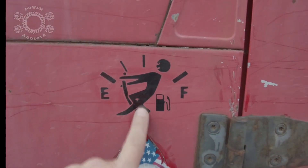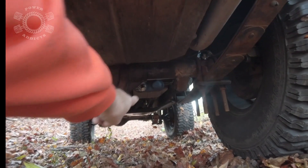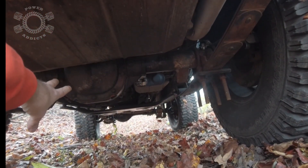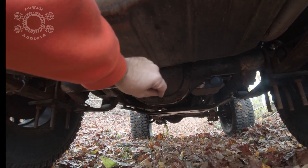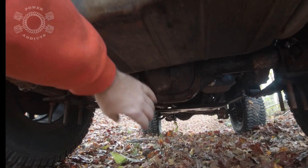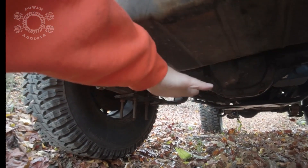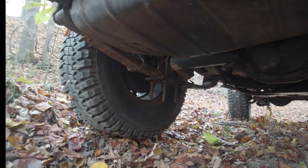First-time Jeep owners discover it gets crappy gas mileage — look, you've got the aerodynamics of a barn. Then you start throwing on big tires, heavy winches, heavy bumpers — this is just how it is. My exhaust consists of the factory header with two-and-a-half-inch pipe all the way back. That muffler is a Flowmaster knock-off — sounds really good, kind of like a two-chamber Flowmaster. There's the 8.8 hanging down. I literally hung it under there, set my pinion angle, welded it in place, and used the factory driveshaft — didn't even touch my driveshaft length. I do need to cut the U-bolts before I go wheeling any harsh terrain.